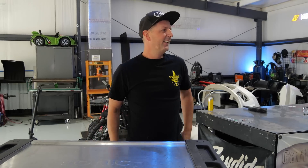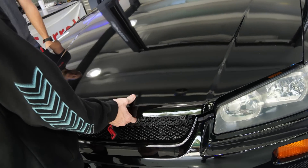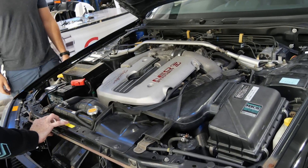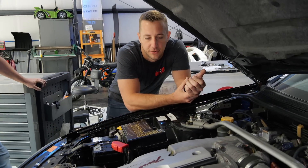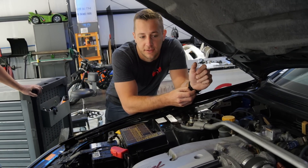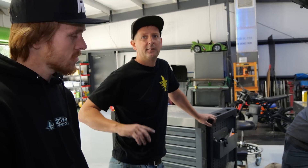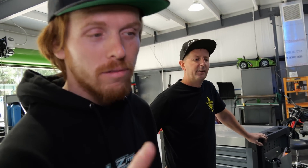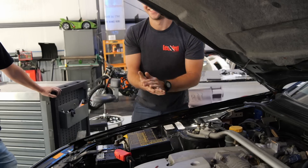Are you going to drift it? Yes. Imagine how incredibly stock it is — good old RB25 Neo, the best one they make. What's Neo mean? It is the newest gen. It has better lifters — solid lifters — it has less over-oiling issues, it has a better oil pump, and you can also fly in the Matrix. I've been drifting on one for like five years, stock bottom end, the Neo. Yep — I have two, one built, one stock. We had that non-turbo Neo we put in the Corvette, that thing gets down.